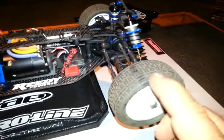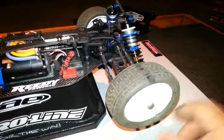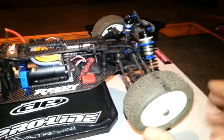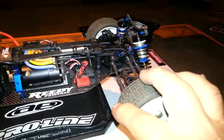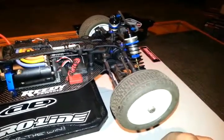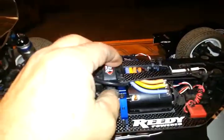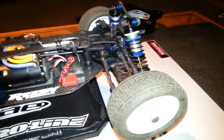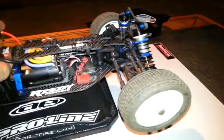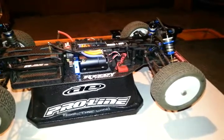Back to diffs — I'm wandering here. At any rate, lazy spin, just a lazy spin. Don't want to get too crazy on it. Remember, this is a lazy spin — I just did about seven-eighths of a rotation with a lazy spin. If you spin it and you only get half a rotation, then you're definitely going to need your hand on that spur, and that's way too tight. I don't even know if racing on carpet you would want it that tight. So anywho, you guys take it easy, I'll see you on the .2 thread. Later.